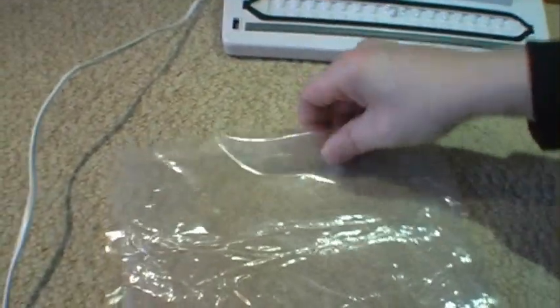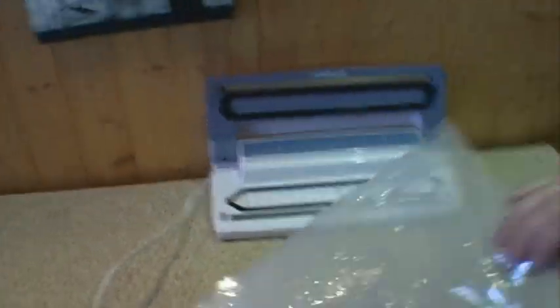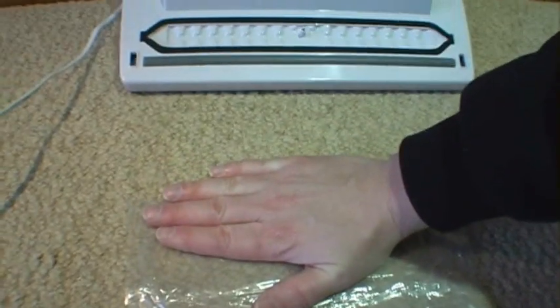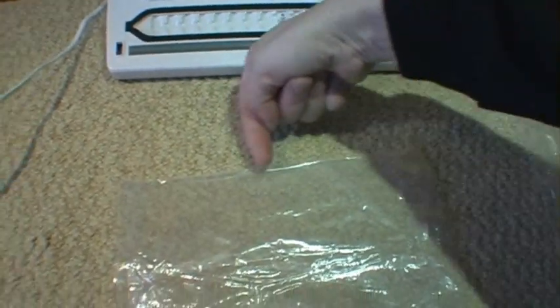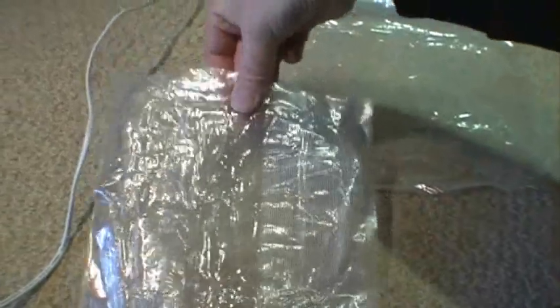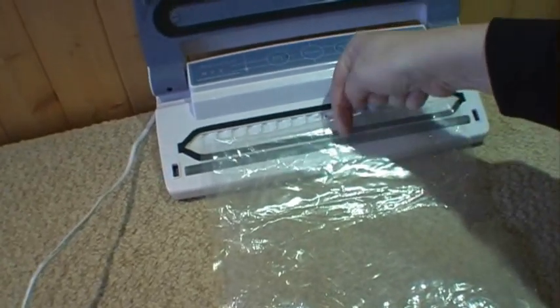So if you're going to go for replacement bags, you need to go for this design, which means there is embossment right the way across the width of the bag. This one is dead smooth on this side, but if you flip it over you can see that embossing texture on there. All that means is when the bag is pressed firmly down, air can still escape throughout. So your vacuum sealer will be perfectly fine, but you need this kind of bag — not the type where you've got embossment going down two sides and smooth plastic in the middle. You need embossed plastic in the middle section, which is where your small vacuum chamber exists.